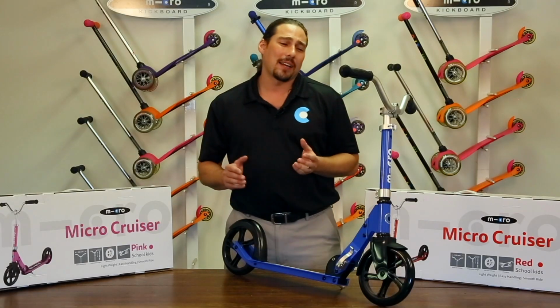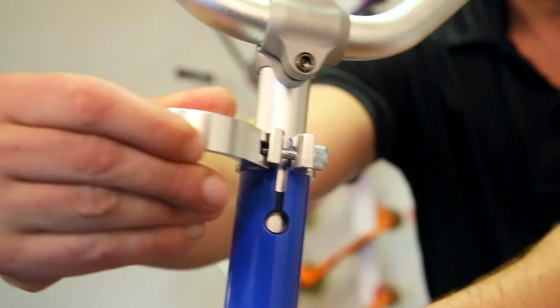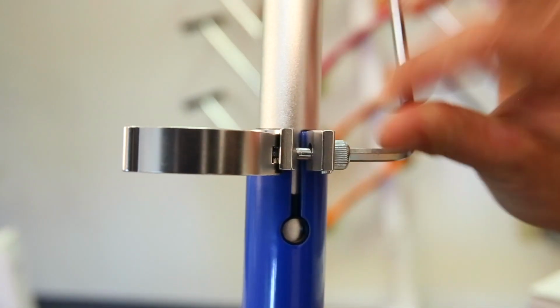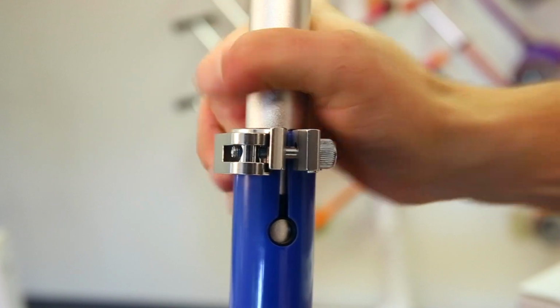This means that you will need to press in the button anytime you wish to lower from the tallest setting. Similar to the folding block, you may need to tighten the handlebar clamp over time. To do so, open handlebar clamp and tighten using supplied Allen key. Finish by closing latch. Closing the latch should be mildly difficult with adequate tension.